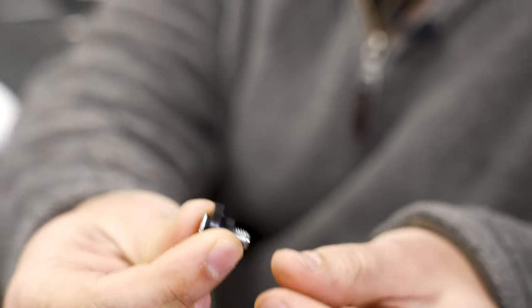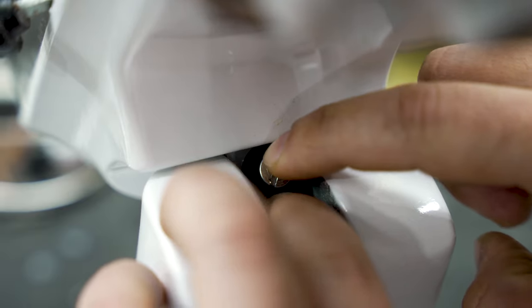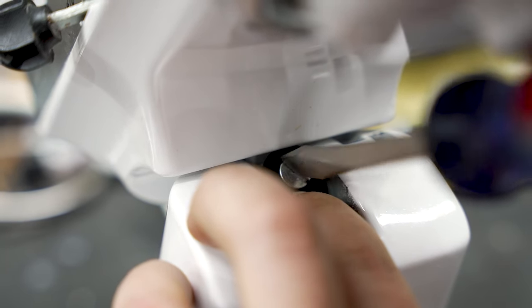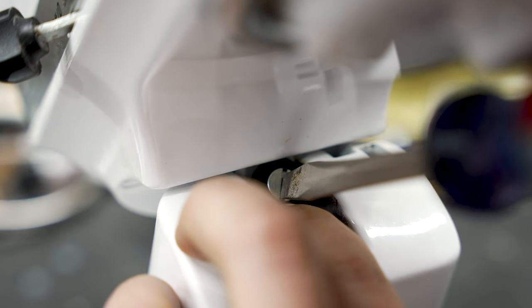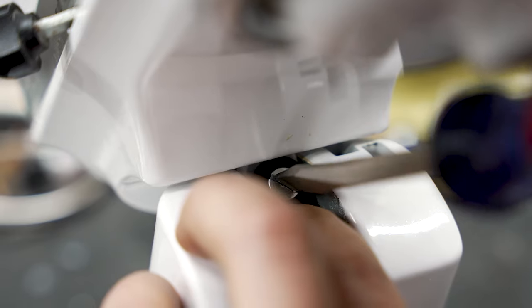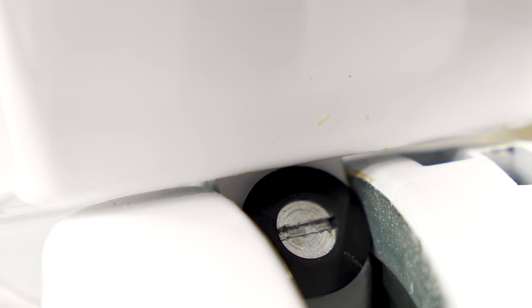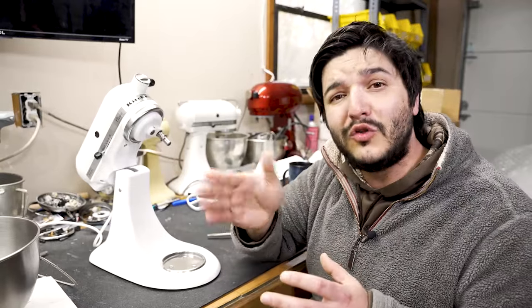Now that we've discussed that, we're ready to install — super easy. The first step is to simply take your screw and slide it through the flat side of the Everdime, like so. Now we are ready to install: simply take the Everdime, put it right up here into this little slot, make sure your angle is looking nice and straight, and go ahead and start screwing it into place. Now if you start to meet resistance, stop and make sure you're actually going in straight — if you're meeting resistance, that means you're probably starting to cross-thread. If it's going in nice and smooth, well, then it's smooth sailing. The goal here is to screw this down far enough to where you see the head of the screw start to bite into the surface of that Everdime, like so. As you can see, the head of the screw is actually receded a little bit into the Everdime. What this does is make sure that the elasticity of that rubber is biting onto the head of that screw so that it can no longer move in and out through vibration. It's a set it and forget it.